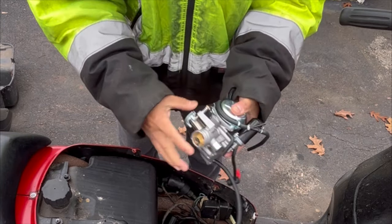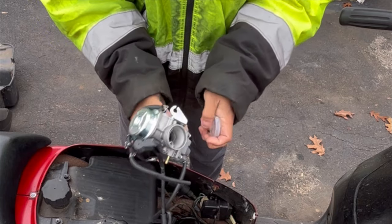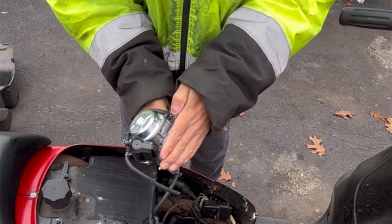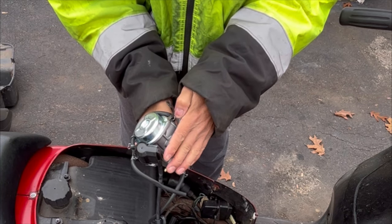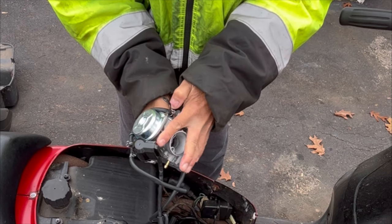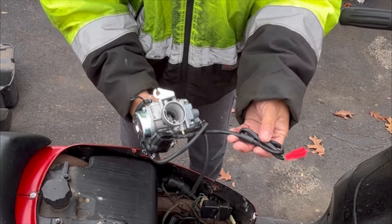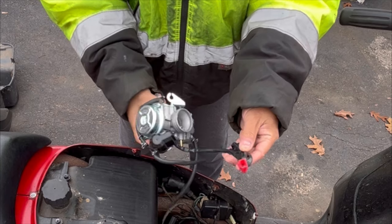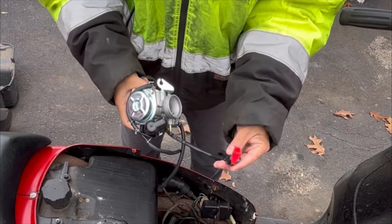Here's the throttle — that opens the throttle plate, which controls how much gas is going into the engine. If I put my hand over it and just open it up a little, it would run perfectly. But close it too much or open it too much and it wouldn't run right. That was my dilemma. This goes to the automatic electric choke, which I'm not sure works right.